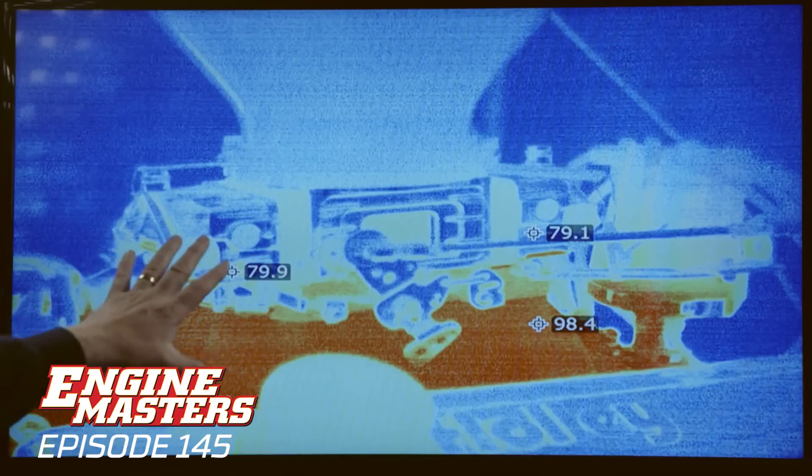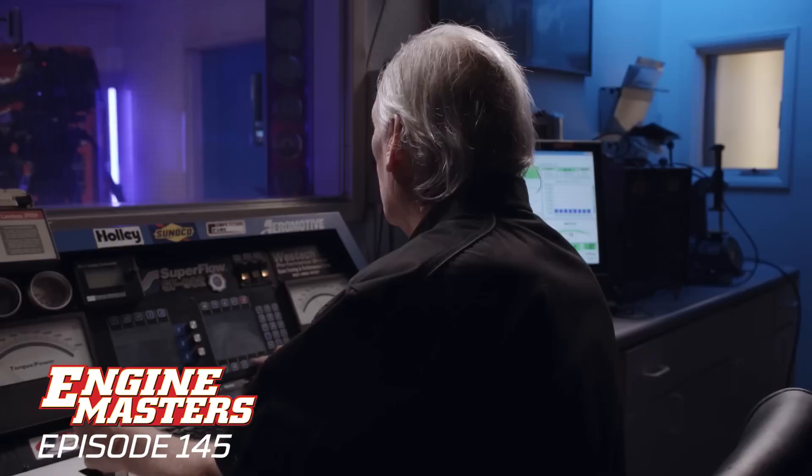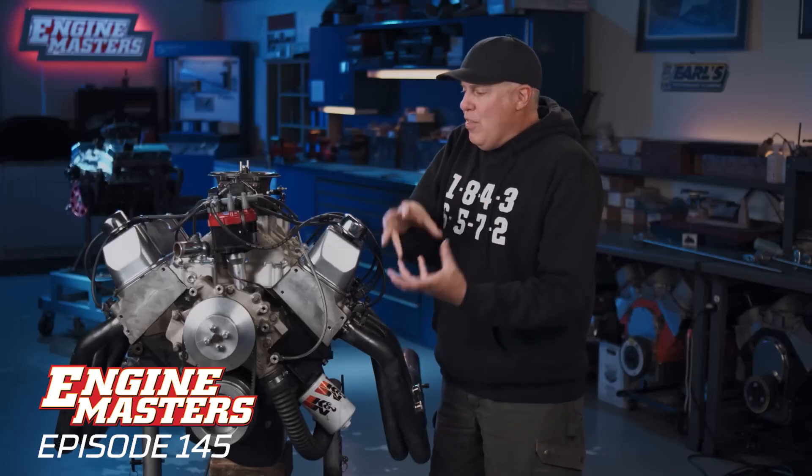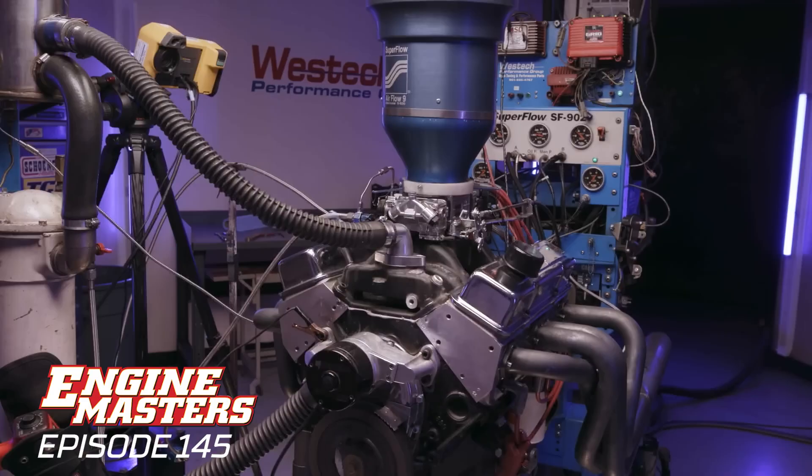We had an infrared camera, all sorts of colors and neatness, and we once again proved that hot gasoline ends up killing horsepower. And then, of course, there's vapor lock. It's an old-school thing, but basically the fuel boils in the system, the gases come out, and the mechanical fuel pump can't pump it. Next thing you know, you're not moving any fuel — you're dead at the side of the road. And for all of those reasons, it also doesn't like boost. So you want cooler gasoline.